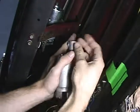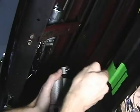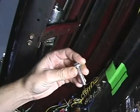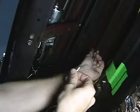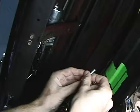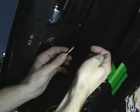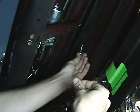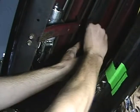What I'm going to do is take these bolts off the top. Got a bolt and two washers. We're going to capture the tab of the vent in between the two washers, go through the actuator, and then put a lock nut and or a lock washer and a nut on the other side. So I'm going to take my nut or bolt and put it like that. I'm gonna put this one on this side